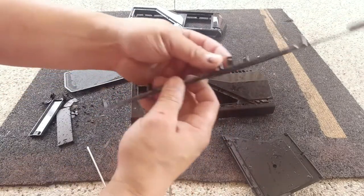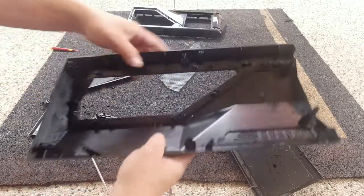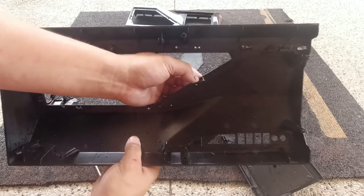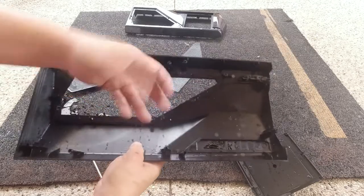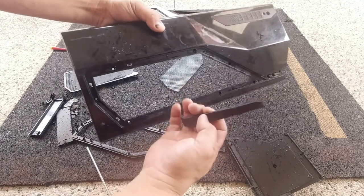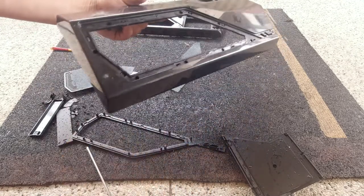When you have a look at it, you can see that you have a tab here with a hole. That clips into this part here, so you separate it here, you separate it there so that you can pry it out. If you have trouble, just use a plastic trim removal tool and guide it along and it will pop out quite easily.